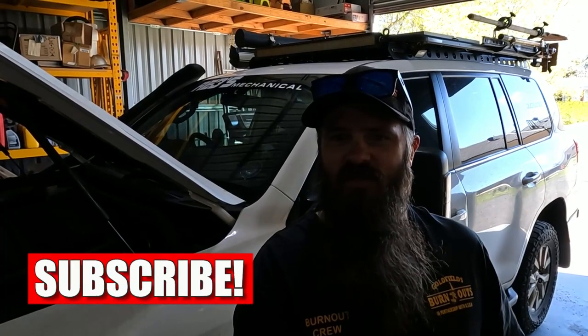If you look in the owner's manual it says you don't have to change the transmission oil ever, which as a mechanic always got to me a bit. Something that would last the length of the transmission, especially with the amount of hard work we put into these cars when we're towing, four-wheel driving, or just everyday driving. I believe you should change the transmission oil at least every 100,000 k's. We're up to about 200,000 k's in this car and I've done about a hundred thousand of that — fairly rough use, four-wheel driving, towing our van, general use. So it's time to give her some love and do a transmission service.